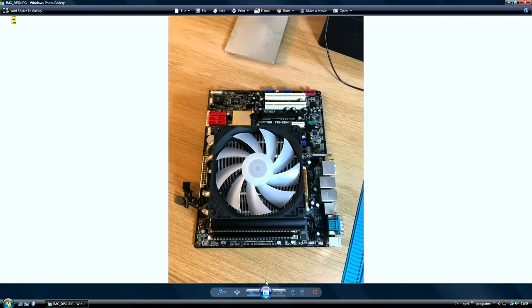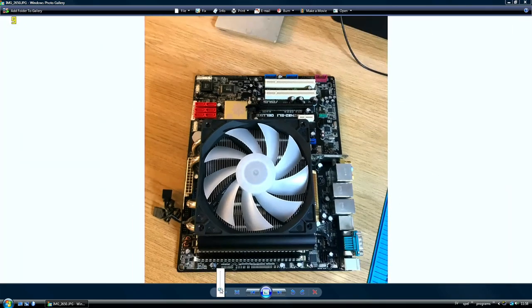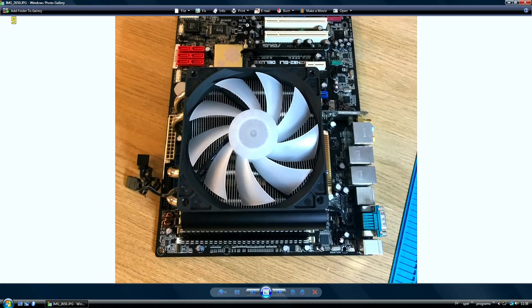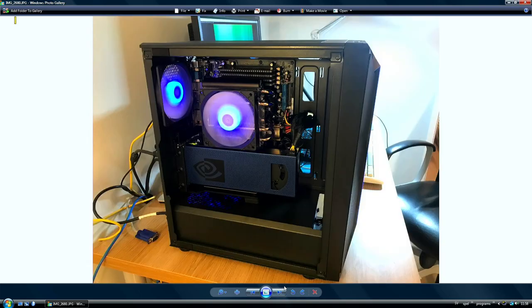So something I also tried was, there's actually a SATA port up in this corner here. Anyway, there's a SATA port here. You've got an eSATA port here, but the internal one here. I did try that too. That's a SIL 3132, but this was equally slow. So yeah, I think Vista with SSDs and faster SATA, it seems to be kind of a pain.